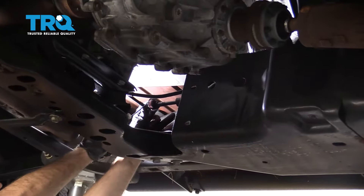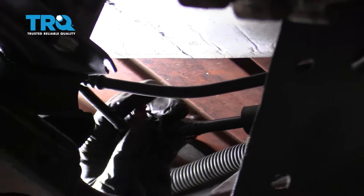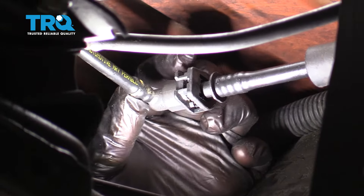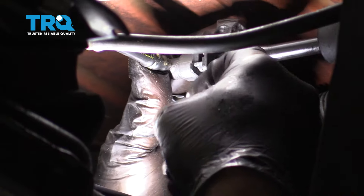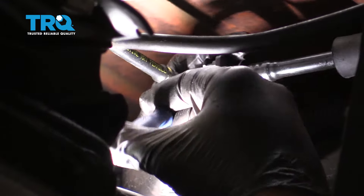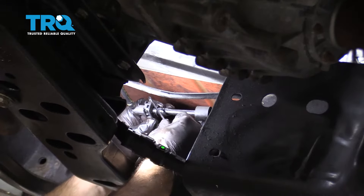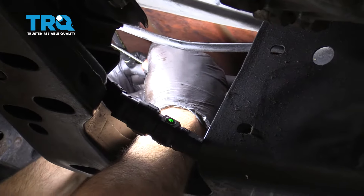Take a pick and release this red tab here on the fuel line, then go ahead and pull that off. Now disconnect these lines here — gently pull them apart. Once that red connector is released from pulling up one side, you can use a small flathead screwdriver and get it up under one of the little tabs. There's going to be a clip that comes out the other side, so release one of these little ears here, then go up on the other side and pop that side out. Using a pick or a flathead screwdriver, go ahead and release the other black clip from the other side.